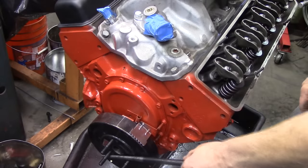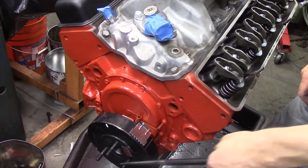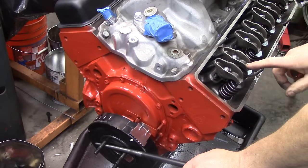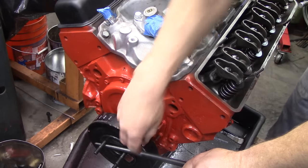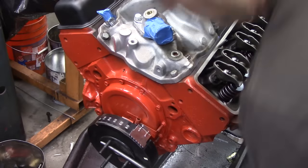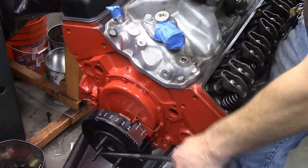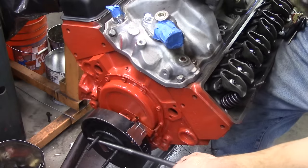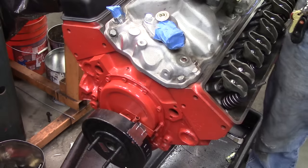We're going to keep going — open that valve up and then let it close. That valve is closing. Now after this valve closes, we just bring our zero mark around to zero on our tab here, and you'll hear the compression. Put your finger over this hole and you can hear that compression. We want to come up to zero, and that's going to put us at top dead center on the compression stroke. So top dead center right there is our zero — we're zeroed out, and right now we're at top dead center compression on number one.